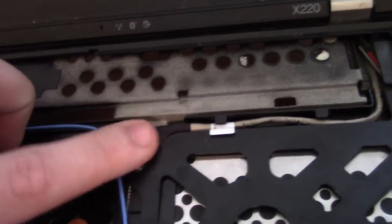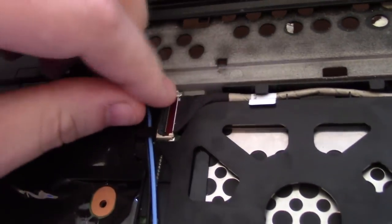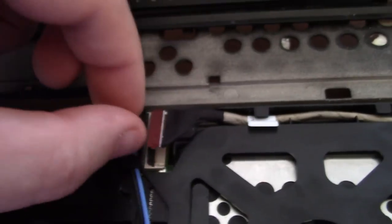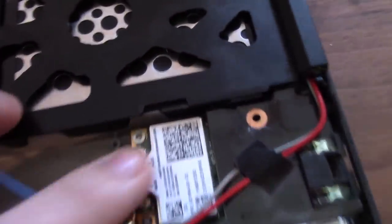Additionally, you'll have little connectors like this one that attaches to the screen. It's similar to the ribbon we withdrew before — there's a little black latch and you want to get it to come up, then you can pry the ribbon out. It's really hard to do with the camera in your face, but there it comes. You just want to take out every little thing and take out everything that connects it to the back lid.